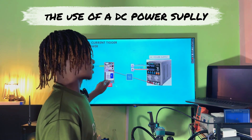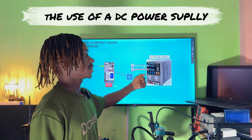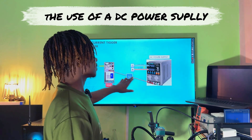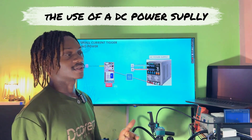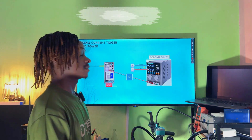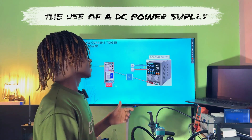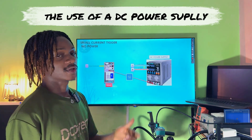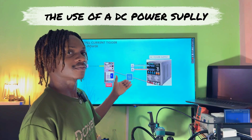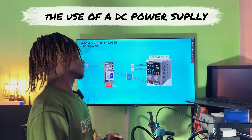If you see, I connect this phone to the DC power supply — that's how we basically do it using a boot cable. Not in all cases will you see me using a boot cable, but you need to keep in mind that without a boot cable most phones wouldn't be able to boot up to the desktop, because they're lacking that battery ID. We use the boot cable because it has its own circuit that emulates a battery, including the battery ID, which is why boot cables can boot the phone to the desktop. In some cases, the phone won't boot even with a boot cable and requires the battery itself.